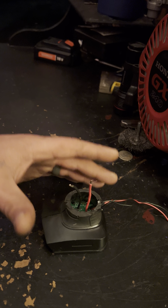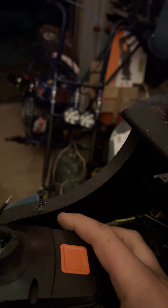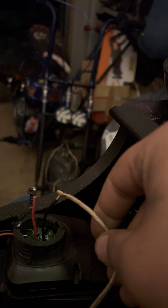I'm going to show you, test it, and show you how it works. We got the bike there — as you can see, the wires are already hanging down, and I got them run up here so I can show you guys. You can take your battery, make sure those two wires aren't touching, connect it up. You're going to take your wires off your bike, make sure you got your positive and negative — always do your negative first, and then connect your positive.